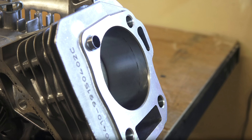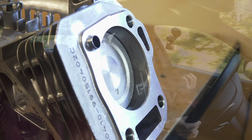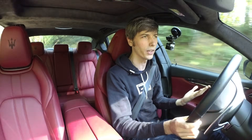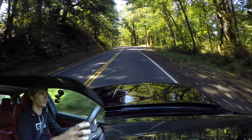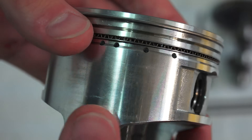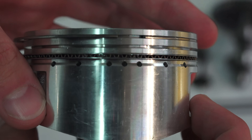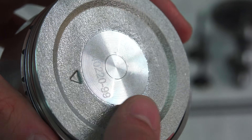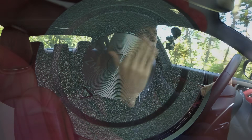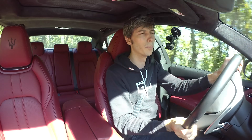Combustion flame temperatures can be as high as 2,000 degrees Celsius, but the pistons are cooled by oil and somewhat by the liquid-cooled cylinder walls. Looking at that 280–300°C range for piston surfaces, you're not really going to have piston deposits forming all that much because you're above the deposit formation peak. It does seem like if you drive hard and bring those temperatures up to 325 degrees Celsius, you could start to get into the range where you could start removing deposits.